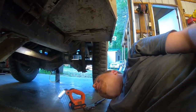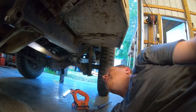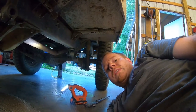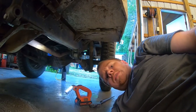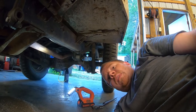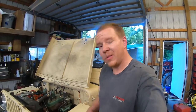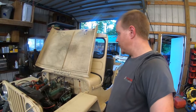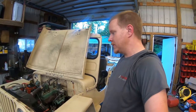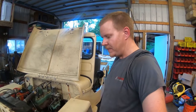The oil in the front and rear diff was clean when it came out, so I'm not too worried about what's in the transmission, but I do want to make sure it's full. Same with the transfer case — I believe it shares oil on this one but I'll have to look. The transmission was about a quart to a quart and a half low, so glad we got that topped off. It does leak a little bit — the owner knows that and it has since this thing got put together.